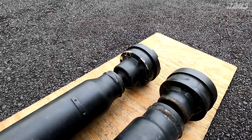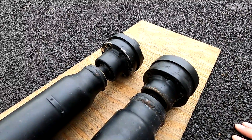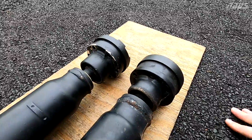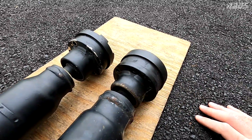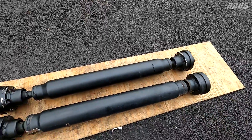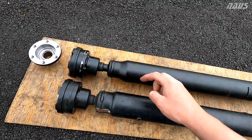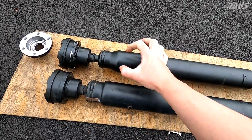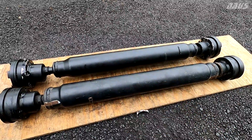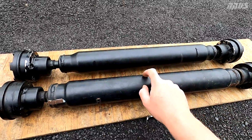It's known that the AP-2 hardware is much easier to torque down and remove without stripping the hexes, since it has a much larger hex due to the M10 thread versus the M8 thread on the AP-1 drive shaft. The design difference is that they neck it down sooner — there's more of a smaller section of the shaft exposed on the AP-1. This diameter itself is a little thinner, though the center sections of each measure the exact same outer diameter: 75 millimeters on the outside.